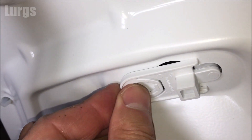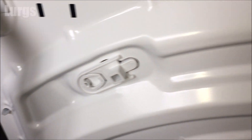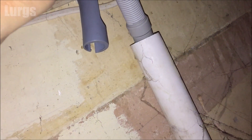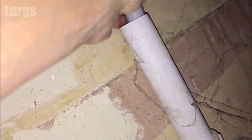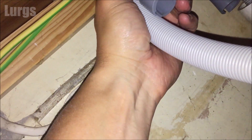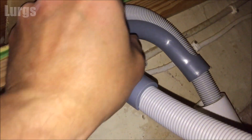You get these clip covers that come with the washing machine — these just clip into the back. Remove all four transportation bolts and put these four cover clips on. Now we'll install the drainage hose. Generally there are two types: one is just a drainage pipe straight out into the public drainage system. If you've got one of these, just put the pipe down about 8 to 12 inches — don't push it all the way down.